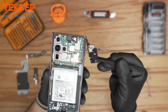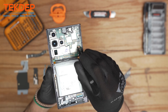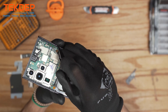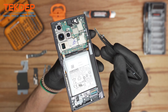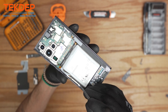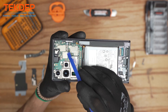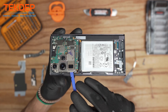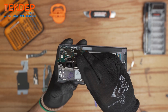Moving on, we're gonna remove the flex cable of the antenna cover, and then we want to disconnect the stylus pen connection as well as the upper 5G antenna module. This is only for the US versions of the Samsung S22 Ultra, as the international version does not carry this piece of hardware. Same for the bottom 5G module. Moving on, this is the upper part of the display assembly that needs to be disconnected, and just like that the motherboard should be lifting up without causing too much trouble.